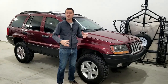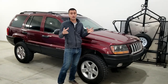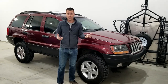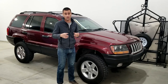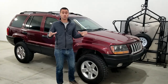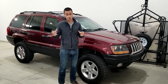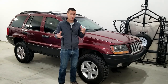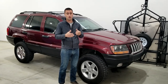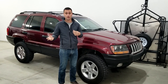On a few of them in the past I've gotten away with putting that rocker back in, but that's a temporary fix because the valve seat could fall out at any time, and if it ever gets hot again the likelihood of it falling out is way, way high. The correct fix is to replace the cylinder head, but these are now old enough that Chrysler and Jeep have discontinued those heads, so you're really only left with aftermarket options from O'Reilly's, AutoZone, that sort of thing.